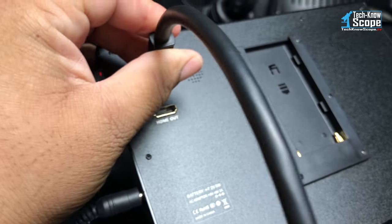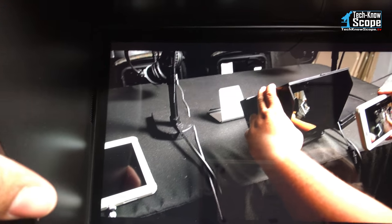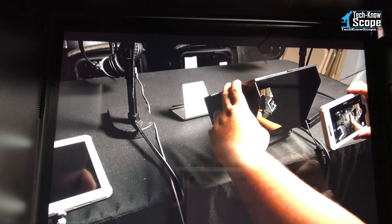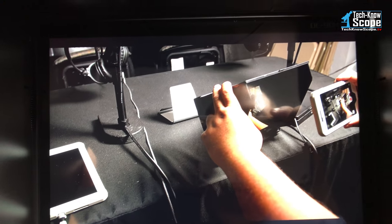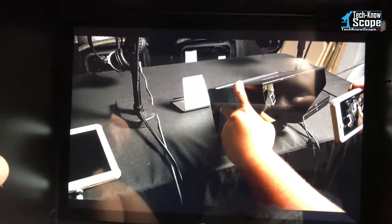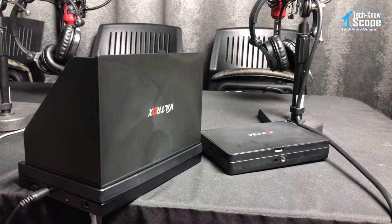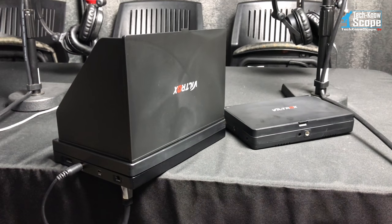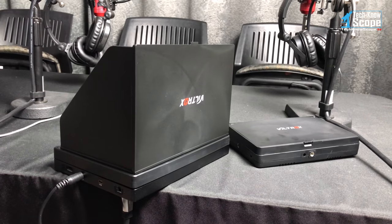So we're going to go HDMI in — and there we go. You can see me, you can see the camera, you can see me holding the phone recording the screen, which is showing the camera showing me holding the phone. Notice there are black bars at the top and bottom — that's because of the 16-to-10 aspect ratio. I'm recording in Ultra HD, which is a 16-to-9 aspect ratio. The screen is 8.9 inches. For color accuracy this isn't the best, but if you need to frame your shot — which is nine times out of ten more important — as long as you've set your white balance and reference colors, framing the shot is usually what matters most anyway.